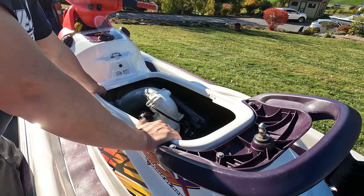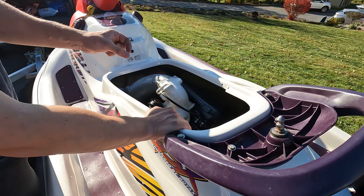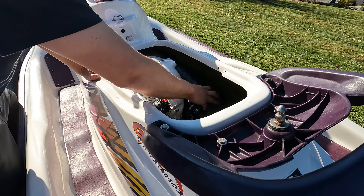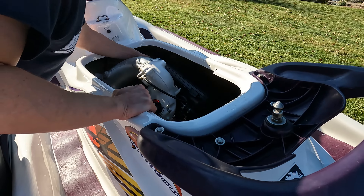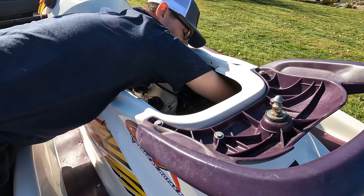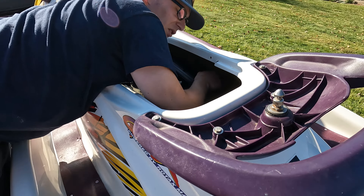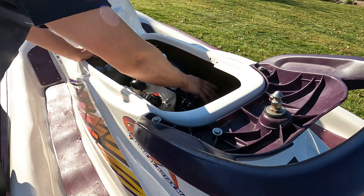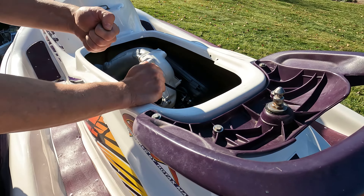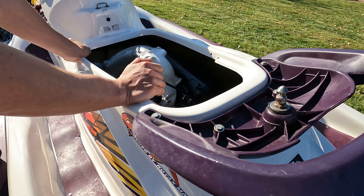On the 787, adjusting the low adjusters is a lot more difficult because they're on the backside of the carbs, so you've got to realize how you're oriented. What you can do is still adjust with the airbox on — you just have to lean in here, pull the throttle lever and carb linkage cable forward, and use two fingers to make the slight adjustment. You've got to get on your chest, reach around, and pull that carb linkage cable forward to reveal those screws. Once you get the hang of it, it's pretty easy.